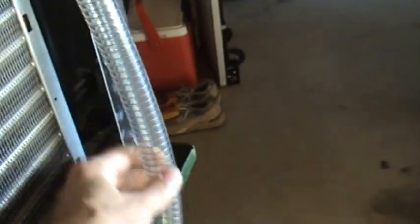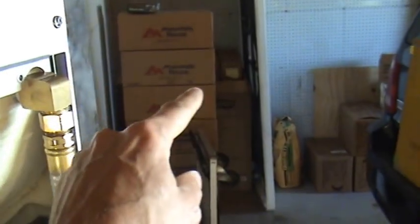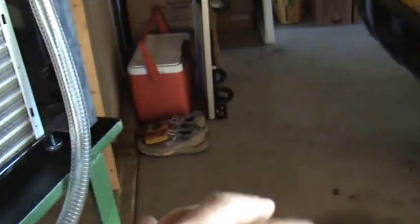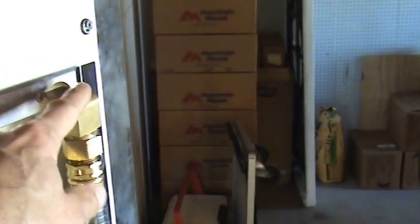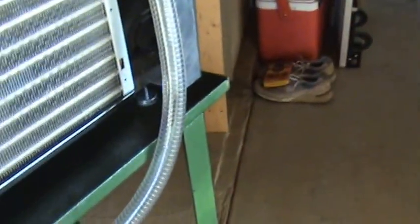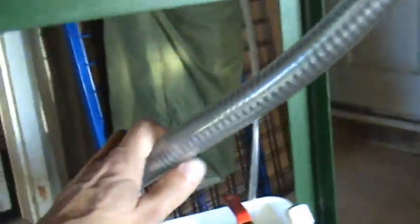What I've done here is I've created a solution because of this hose. I wanted to eliminate the problem with this hose. The hose coming out here is the vacuum line — it's a pretty heavy hose, it really doesn't bend very well, and it was coming out straight at a 90-degree angle out of the machine. Then basically you had to put a pretty gentle bend for your pump on a table next to your freeze dryer. I didn't want to do that — I wanted to put mine on a cart. The hose that came with it was way too short to do that, because by the time it came out at a 90-degree angle from the freeze dryer and made a slow bend down to the bottom of the cart, you need about a foot more hose. And it still wastes a lot of space.